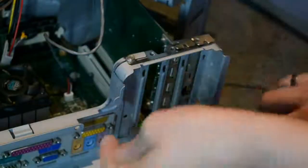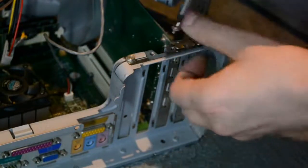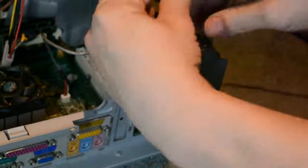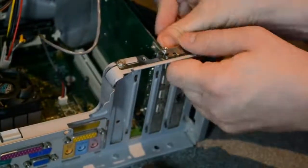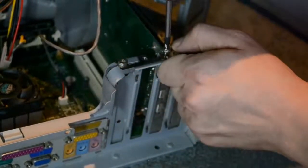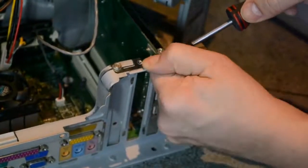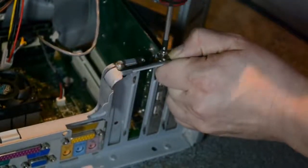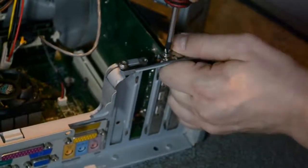So just probably a 56K modem. It might even be a software modem where half of the functionality of modulating and demodulating a signal was done in software, because computers were powerful enough to just do that and not need supporting hardware for it. Instead of basically having a totally separate computer inside the modem box, which is not quite how old modems did it, but they were more capable on their own. Old modems basically only just needed a serial connection, and if you send it characters, it will work.